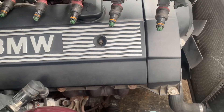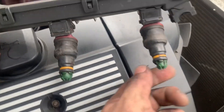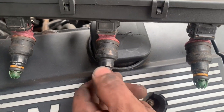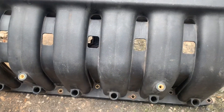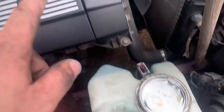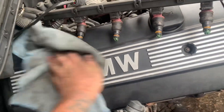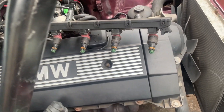An important thing to do is grease up your injector rubbers. You don't want one of them not sealing properly when you're sticking it into the manifold. I've just given the manifold a clean — make sure you put a bit of grease around your injector seals before you put them in, because you don't want them leaking on a hot engine. Little tip for you.